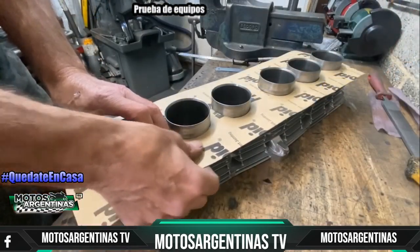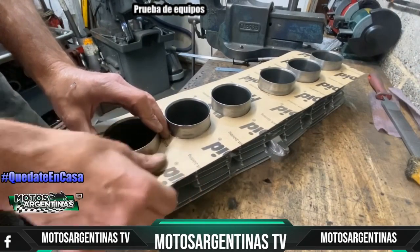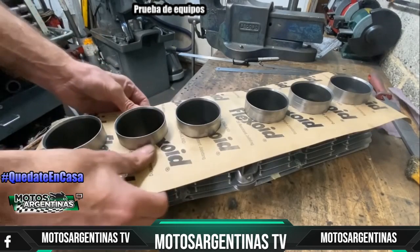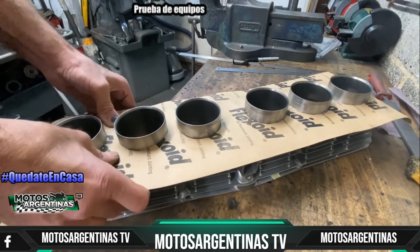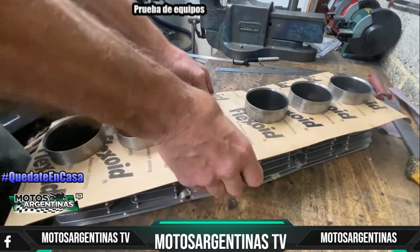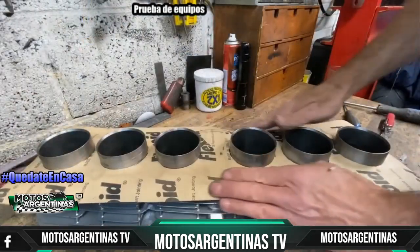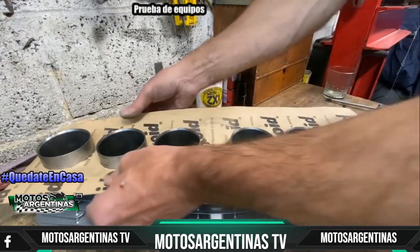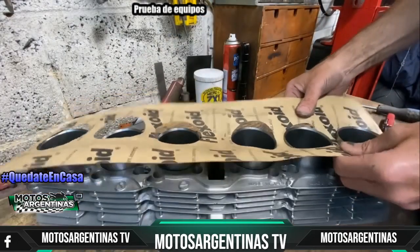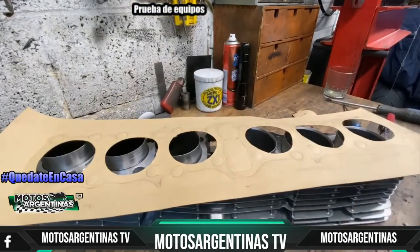Now, using my thumb and fingers, I press down hard, following the periphery of the barrel, so that the edge makes a sharp impression onto the gasket paper. Also pressing down tightly over the holes with my thumbs and fingers to make an indent that can be cut out later. And here is the impression to be cut.